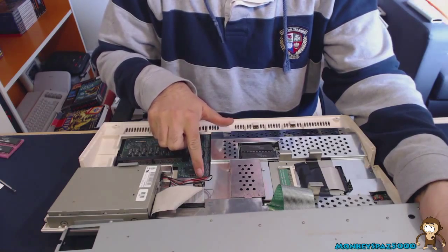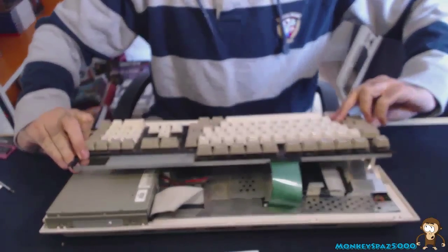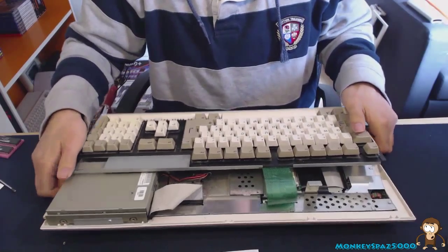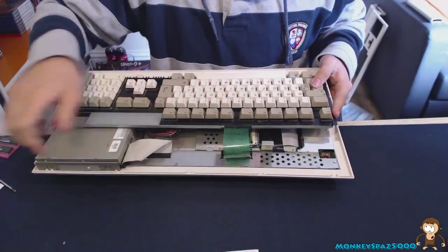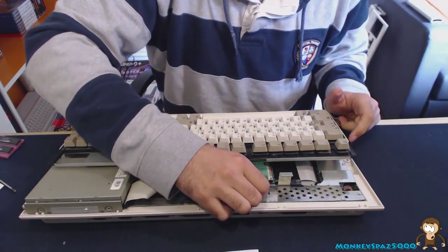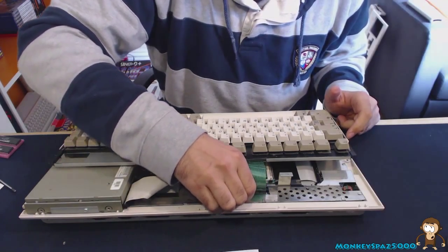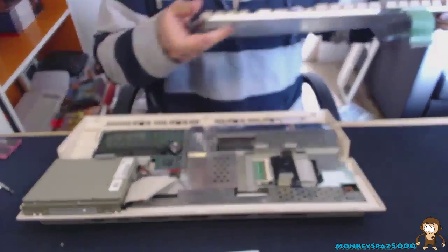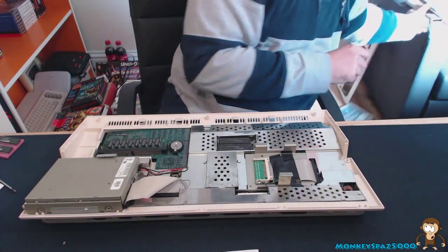To remove the LED cable, flip your keyboard up and it just unplugs — it's just below the floppy drive power cable, it unplugs straightforwardly. The keyboard itself is held in place by a little ribbon cable. You can see the little white connector. Be very careful with the old hardware — just pull it out gently and the ribbon cable comes out completely, then you can lift the keyboard away.